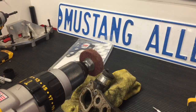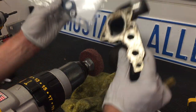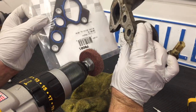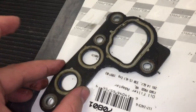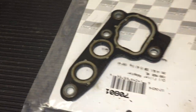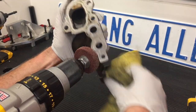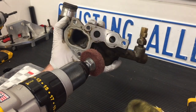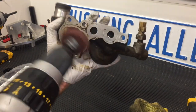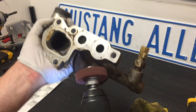Here's our new gasket. You want to make sure it's going to match up — it looks pretty good. Take the old gasket and set it over the new one just to make sure everything lines up. We're looking good, but we want to clean this mating surface so it doesn't leak again. You can wipe it off — this is like a scotch pad, like the back side of a sponge, which works really well.